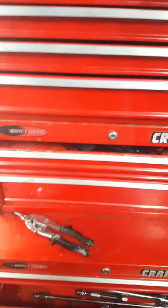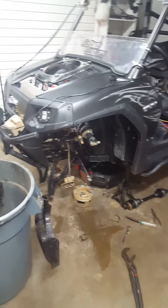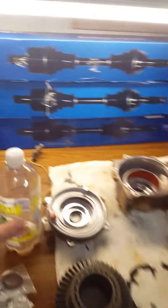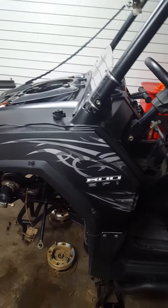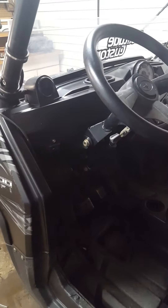As far as the front end, tie rods are still doing good. I need new brake pads all around — riding on river sand just eats them up. My brakes were never that great; the pedal would barely go down but it would still stop. I figured out why: the brake fluid was overfilled and it was sticking. Now I've bled the brakes starting from the farthest from the master cylinder, and the pedal works good — it's not tight anymore.